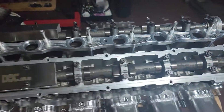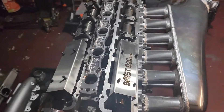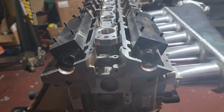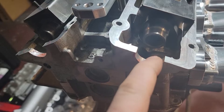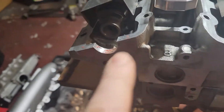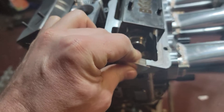Let's take these things off so we can see what we're dealing with. It's just a standard RB25 Neo head, and all we're going to do is apply a thin layer of sealant along the inside of the Half Moon on the head on both sides, and then we're going to take our seal and set it in place.